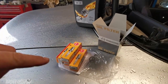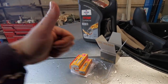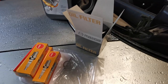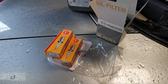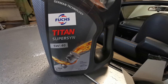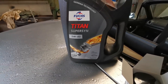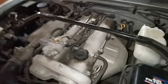So these are all the bits I bought - most of this came from mx5parts.co.uk, shout out to those guys. NGK plugs, because always NGK plugs. Mazda genuine oil filter - not for any particular reason, it was just as cheap as the others - and that came with a new crush washer for the sump plug. Then some Fuchs 5w40 fully synthetic. Some people said run 10w40 semi-synthetic but I think the 5w40 is going to do a better job and it lasts a bit longer.